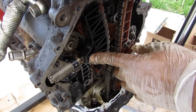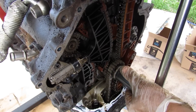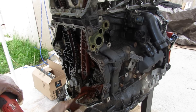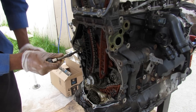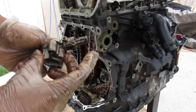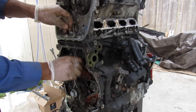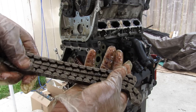That sound you're hearing is the engine skipping timing at the bottom because this ratcheting mechanism inside has completely failed. The chain tensioner issue was more common in vehicles from the late 2000s and early 2010s — they changed it for later models to make it more reliable. But if it does fail it will eventually result in catastrophic engine damage. I'll remove the timing chain guides and the main chain tensioner — there's the culprit. Some EA888 engines also suffer from stretch timing chains, which would have similar effects — loss of timing and potential engine damage.